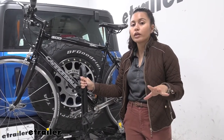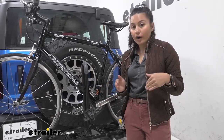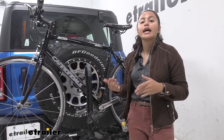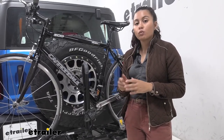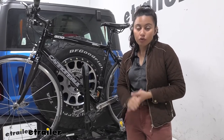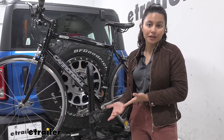The main thing with the Ford Bronco is the spare tire in the back. Right off the bat, this bike rack does not go out far enough where we can fold it up and have clearance with that spare tire. Another thing is that we are currently using the Draw Tight hitch, which is one of the hitches that are a little bit further out and give you more clearance. So if you have the factory hitch or another hitch receiver, you won't have the same types of measurements as we will have here.